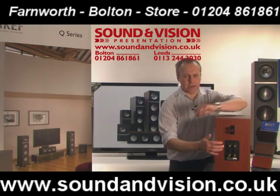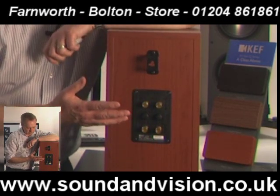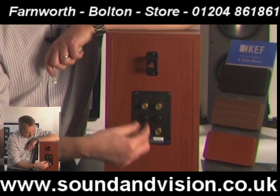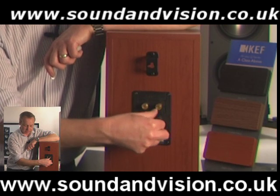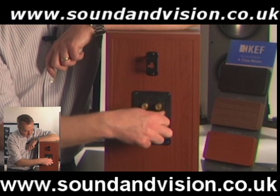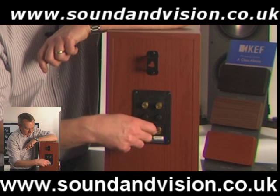So let's take a quick look at the back of the Q300. What you've got on here is your speaker terminals. There's been a complete rework of the design of the crossover in this range of speakers. If you want to bi-wire or bi-amp this speaker, the terminals are positioned below and above, and the controls in the centre just unscrew — so you don't have to remove any links, just unscrew those and you're equipped for bi-wiring. If you're just wiring from a single source, simply screw those down and attach to the bottom two or the top two terminals.